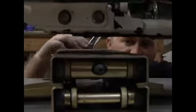there are no wires or objects that can be pinched or damaged. For instance, like these shocks, I do not want to put the scissor jack on the shocks themselves. What I want is to put it on the frame, on both sides of the frame here. There are no objects, so now I can jack up the scissor jack.